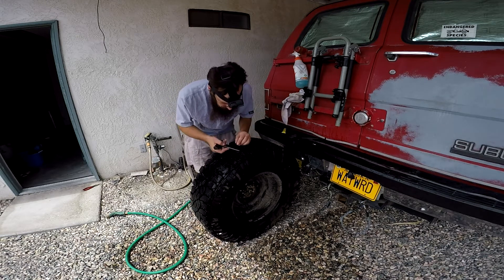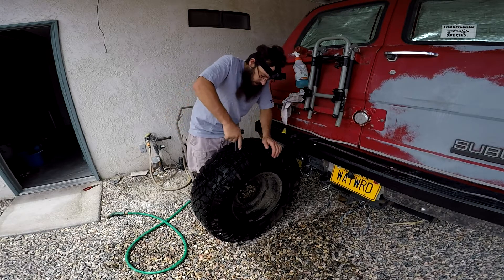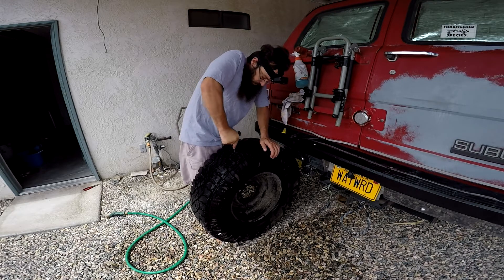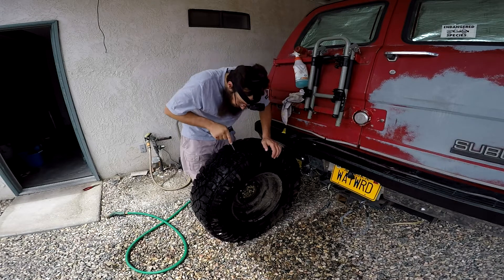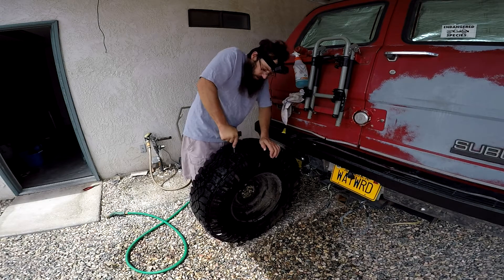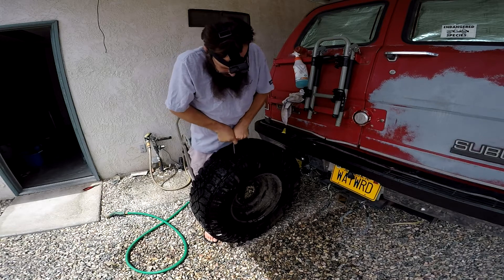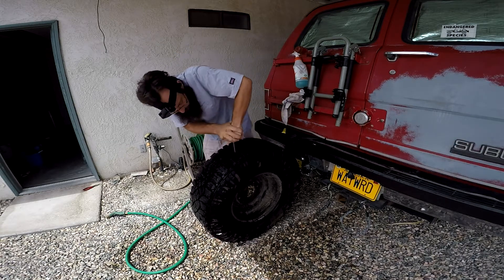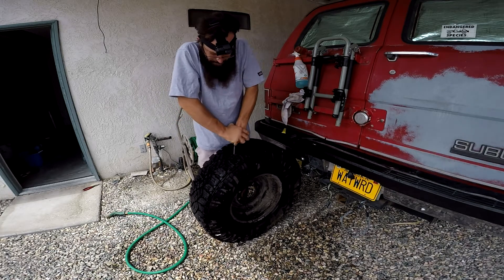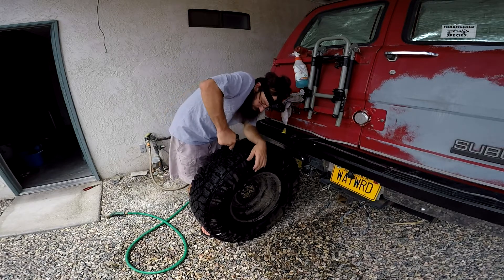Another thing you're gonna need is a rag, just because glue will get everywhere. First off, besides inspecting our hole, we take this tool — the raspy bit thing — and we just kind of take our time and feel our way down into that hole. You don't want to go making a new hole because you'll plug a hole you just made and not your leak. On this heavier tire you have to kind of get after it — just find your way down into it. I can feel I'm still along that piece of metal.